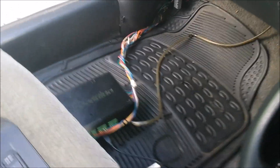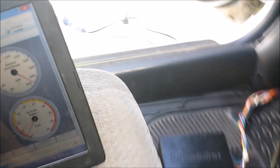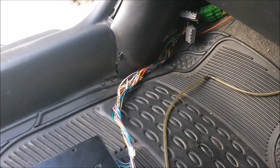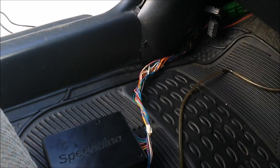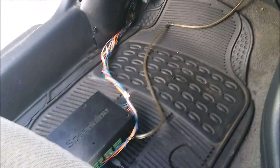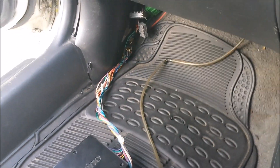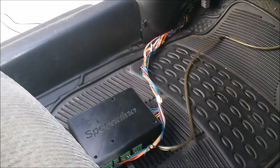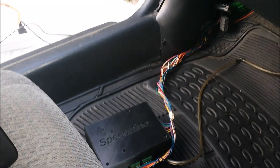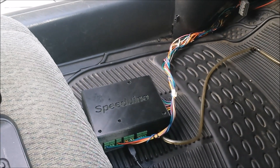She's running! In a nutshell recap: Speeduino v0.3, wired directly to the stock Honda harness. This can work for OBD0, OBD1, OBD2 — whichever Honda you have. In my case this is a '97 EK sedan with a D15. The base map I supply can work on any setup — you can tweak it from there to run on a B series, F series, H series, whatever. Hopefully this was helpful. If you have a question leave it in the comments, like, subscribe, and share. Till next time, stay safe guys.